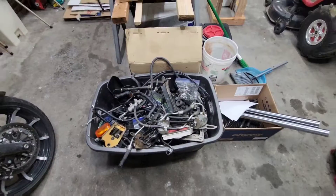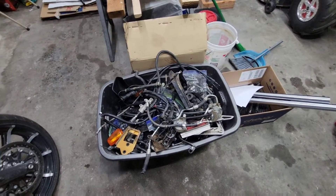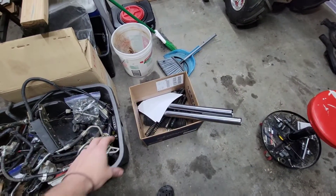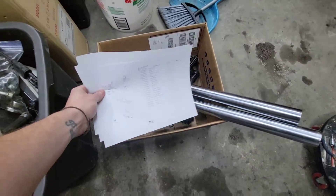Seat. So far we've disassembled the motorcycle — we've got all the parts inside this bucket, not very organized, much like my toolbox. For front suspension, we're going to go with stiffer springs, full springs, get rid of the spacers. We're waiting on the lowers to get back from powder coating.